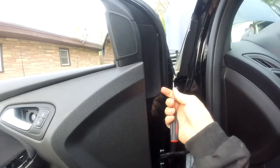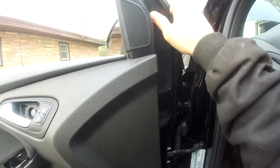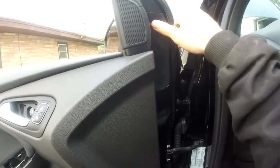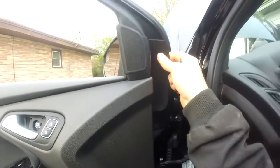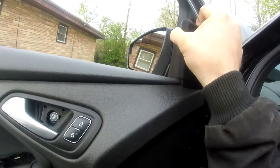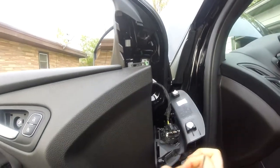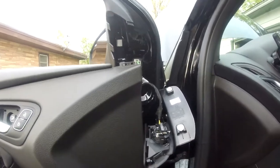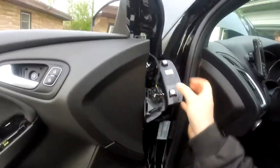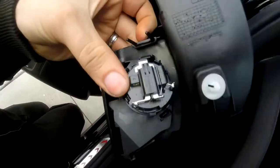Removing the little tweeter cover — just gently stick underneath and give it a little pry. The little plastic pieces will release themselves, and there's that little metal one. Revealing what needs to be done for the tweeter section. All we've got to do is squeeze this little tab right down here. Voila! And then that takes care of the tweeter section.